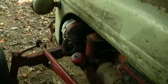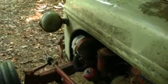For people using three-wire alternators, you have to put a charge light somewhere or use a resistor to trigger the alternator — it just lets you know when it's not charging. With a three-wire alternator there's more wiring involved; one wire is your charge light, the other is your voltage-sensing wire, and one usually goes to your positive terminal. With a one-wire alternator you just go straight to the battery and don't have to worry about any of that — similar to a one-wire Briggs and Stratton lawn mower setup.